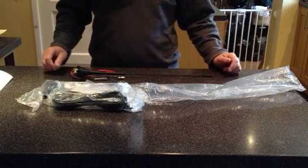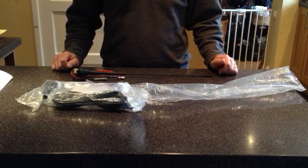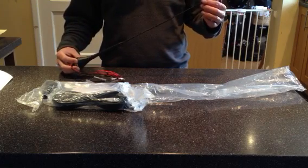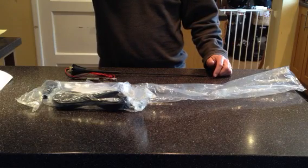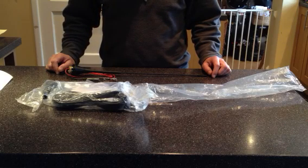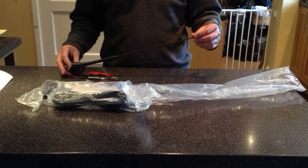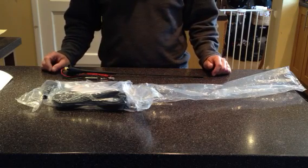There's the DRA-6003. The 601 and 603 are both made in China. The 601, which is this one here, has a 440mm antenna. The 603 only has a 230mm antenna. You may think that that's maybe slightly better with it being shorter, so it's slightly more discreet on your vehicle, but you will find that the 601 will give you a slightly better reception on FM and AM than the 603 slightly shorter antenna, so bear that in mind.